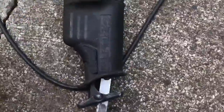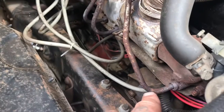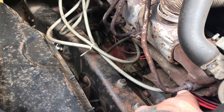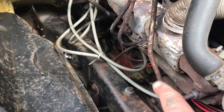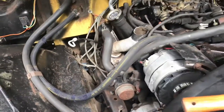I'm going to take my sawzall and cut all the tubes coming off the exhaust manifolds. I'll probably leave a little bit on there, pinch them down, and weld the ends. I'm thinking about cutting flush for a cleaner look and then welding. Since this is a 350 I can get my torch in there — a 454 might be a little tight. The tubes are very rusty and don't want to move, so the sawzall is the way to go.